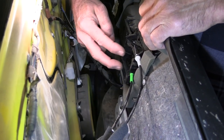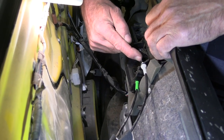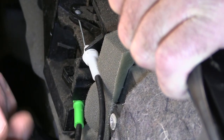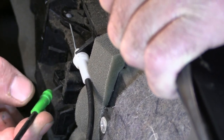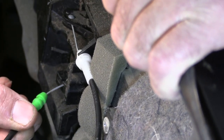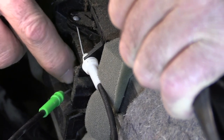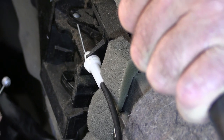Now there's a couple of things behind the panel that we have to take off in order to get the panel completely off. These are the cables going to the lock and the door latch, and the wires going to the electric windows. To get these off, start at the bottom one and pull it out of that little channel there that this green thing is down in. Then move the cable up here — there's a little channel right here that you can get that wire up and get that ball out of that mechanism.